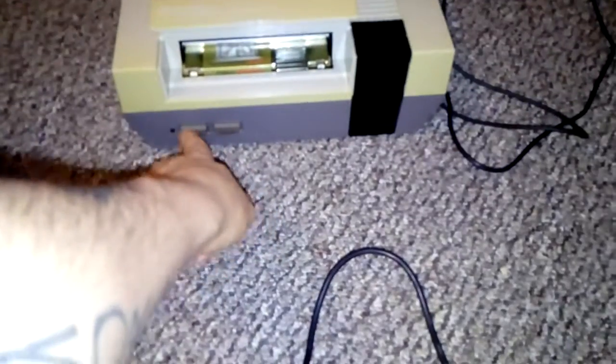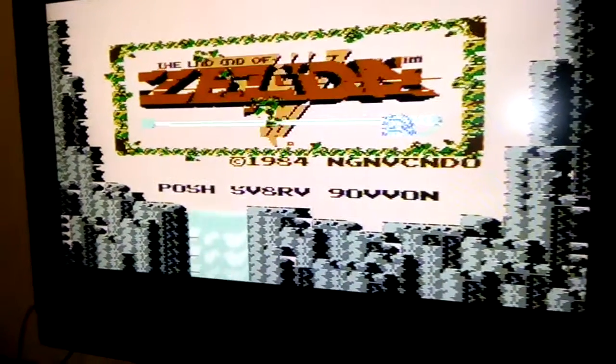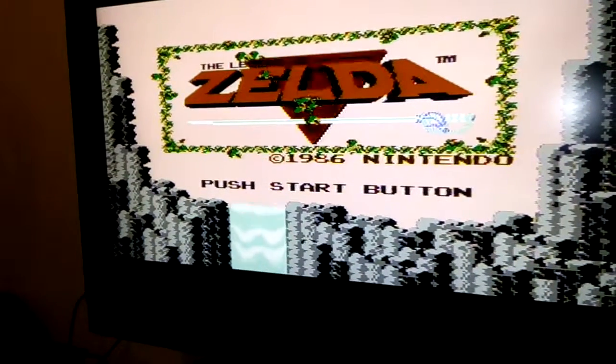Okay, and to prove to you this is not the one I've been working on. Look, see, it's still solid. This is the one I've been working on. Alright, so now let's press power on. Oh, she's a bit bumbled. So let me just reset. There she goes. Alright, reset that again for a second. Okay, she didn't like that. Right, let me just make sure she's in tidy. Ah, there she goes, look. It just wasn't making contact with the cart then, with the 72 pin.